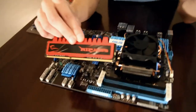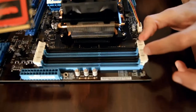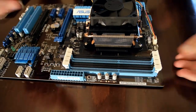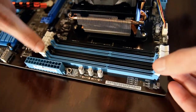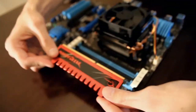When it comes to installing your RAM, if you only have two sticks they're usually better installed in pairs — you see these two black slots here, you'd install one in each of those. But since we got four, we're gonna be plugging all of them in. So we'll go ahead and open up these little clips on each one of them.